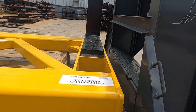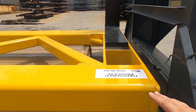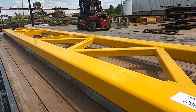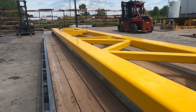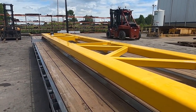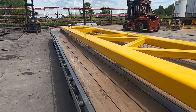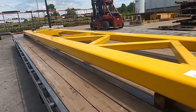Usually when I put my straps up front, it's a lot closer than that. If this was 45,000 pounds on an open deck flatbed skateboard, I would probably put a strap right in front of the dunnage and right behind it. But anyway — so 30 feet. We need a minimum of three straps. Would that cover it? Absolutely. I don't do it that way. I was taught a long time ago — every four feet for lumber, and that applies to heavy loads too. It's never failed me. I've got the space, the straps, and the time. There's no reason not to. You can always over-secure. You can usually under-secure one time. Remember that.